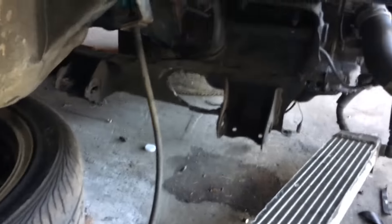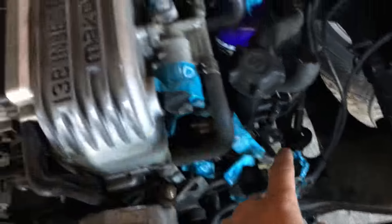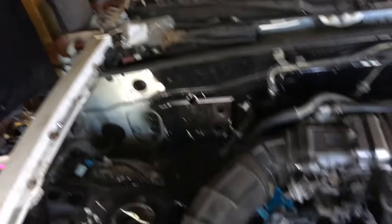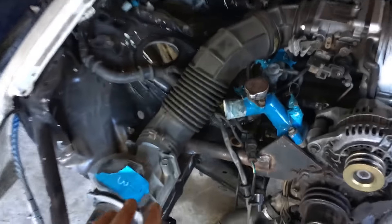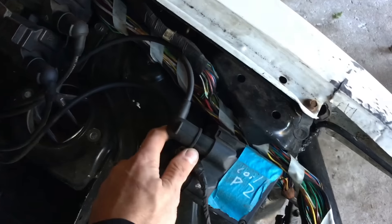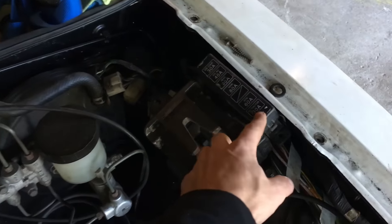It's just sitting on tires because there's no subframe besides these pieces, and the rear is all together. Got the intake on there - fits fine, we can use the stock one. Got most of the wires hooked up, all this is hooked up under here, runs into there, got the stock boot on there, and the ECU is right in behind there. That's the engine harness - on a regular car everything plugs in and you'd start it right up. But on the rotary you have these coil packs and only like four wires are in here to monitor the coil packs and send signals from the fuse box.